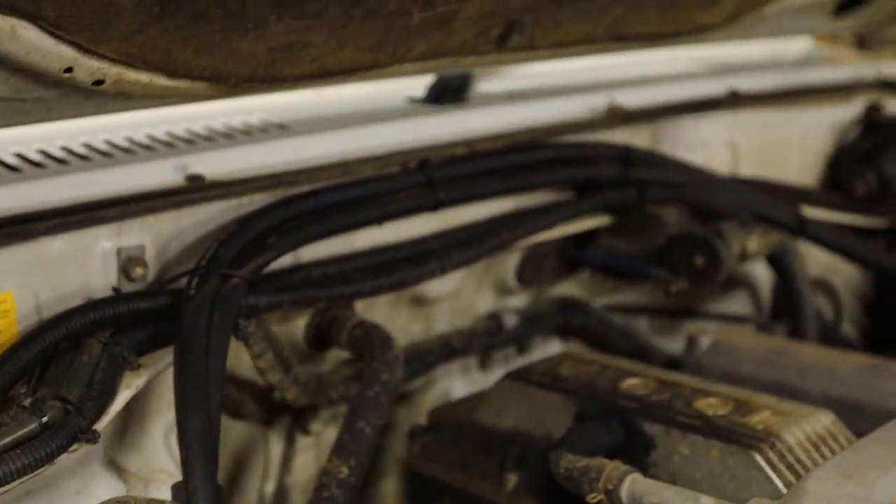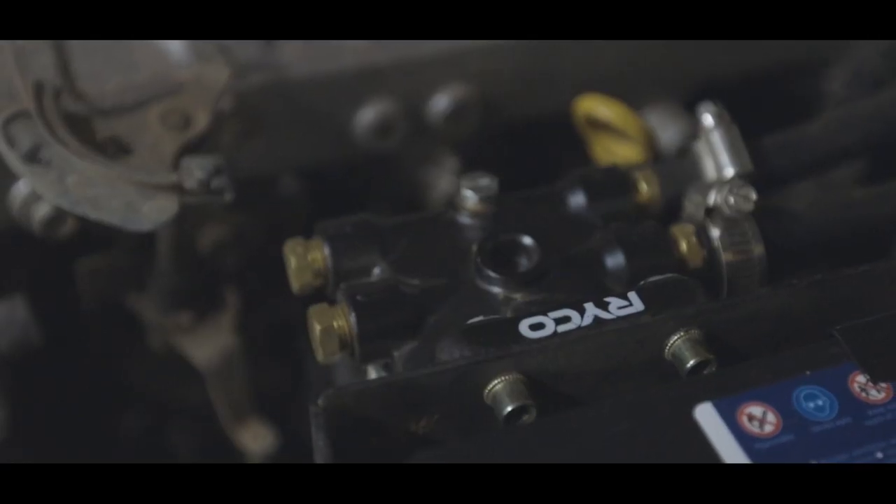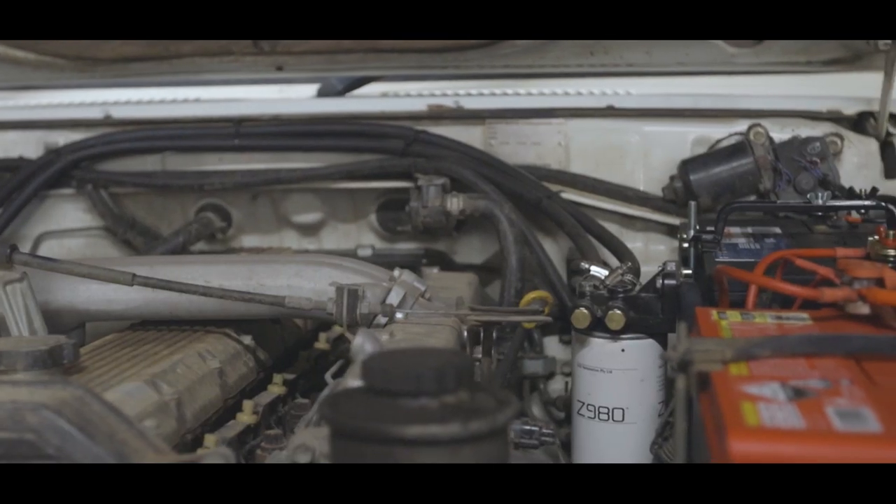They neatly run up along the back and to the fuel water separator. Fairly simple how this works — fuel comes in, goes through the filter, the water drops down to the bottom and you can undo the bottom to drain it, then it feeds back into your other filters. All in all, that's a very easy mod that I definitely recommend. It's not too expensive, it could save your engine, so it's definitely worth throwing in there. Just set it and forget it, then change the filter every 40,000 Ks.